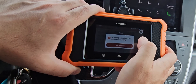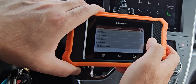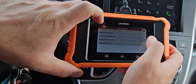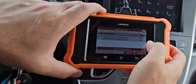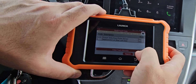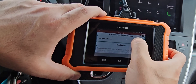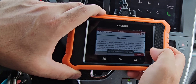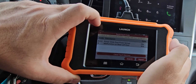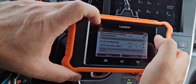There's an actuation test option with things like PSD motor, PSD clutch, buzzer, and PSD open — but I'm not going to do those right now. The full fault code reads: power door pulse sensor malfunction in rear left door. You can do a report and basic diagnostic point on the vehicle, and if you're connected to Wi-Fi you can share or email it to yourself, or take a screenshot.